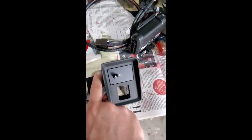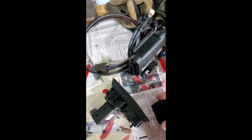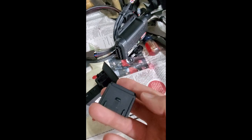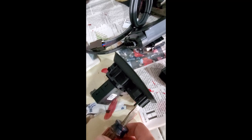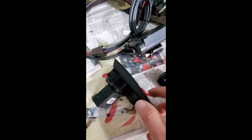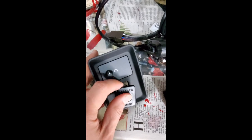Once you get the panel out, you can take this blank button out. The blank button pushes in from the back, so you're pushing it this way to get it out. The way it's held in is there are tabs — two on this side and one on the other. You're going to need a kind of narrow screwdriver, just get it in there to give a little more room while you're pushing the blank button in, and it'll start to move. You'll get it out as a damage-free piece that you can use to install whatever else you'd like, for example your trailer brake controller, which will neatly fit in the same spot.